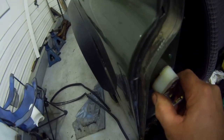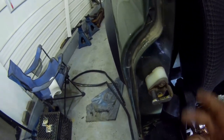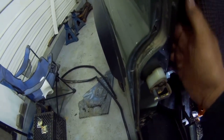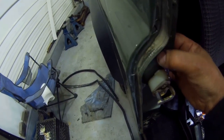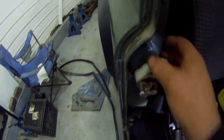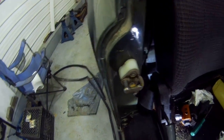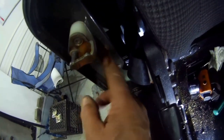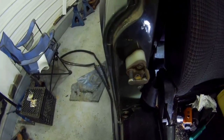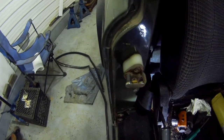A little fix I do is — there's a plate at the back for captive nuts — I make a new one but bigger, and then screw that plate onto the door frame to brace it up a bit and make it stronger, picking up off these bolts here. I'll put a plate in right at the back, pick off these bolts, and put a couple more bolts in. There's not much you can do if you haven't got a TIG welder.